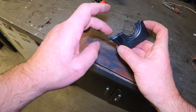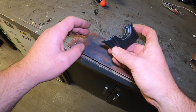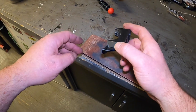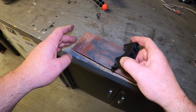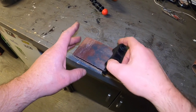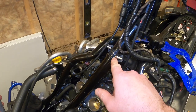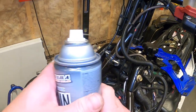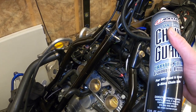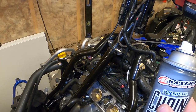Take a little bit off this piece too where the throttle cable goes through, so everything mounts up tight without putting stress on anything. It's a process — work at it, go back to the machine, test fit it, take a little more off. Take a little bit at a time because you don't want to take too much off and make it too tight. Once you've got the right amount of material removed, put it back together, and add a little grease or some motorcycle chain lube dribbled down in there for lubrication to help prevent wear.